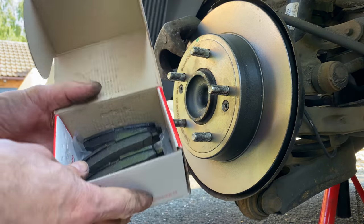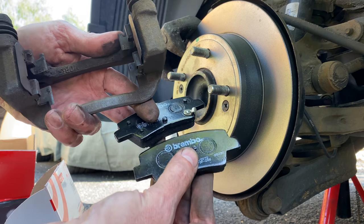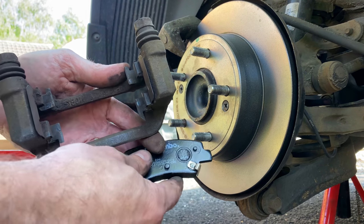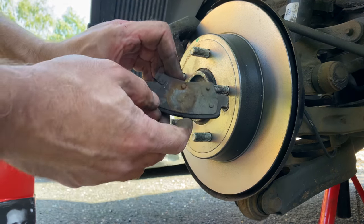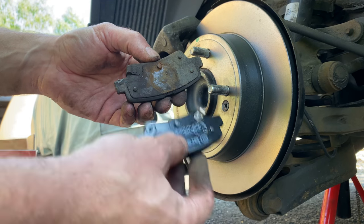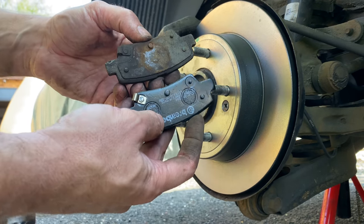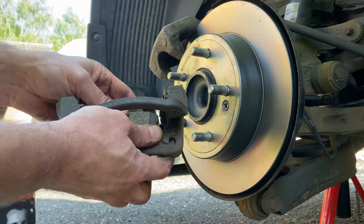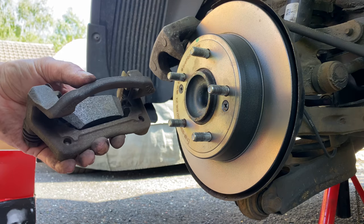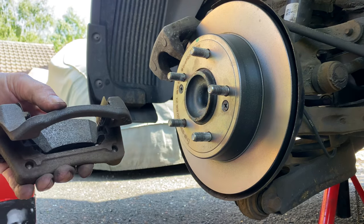Getting my new pad box. Now what's interesting to note is two of these pads have these clips on and two don't. They've also got different lugs on the back and I've got no idea what that means. We can figure out which one goes at the back because I can see on this one where the piston was making contact - so that needs to be that one because you can see the metal tab, it's the right orientation. They have exactly the same part numbers, so I'm going to say there's no difference.